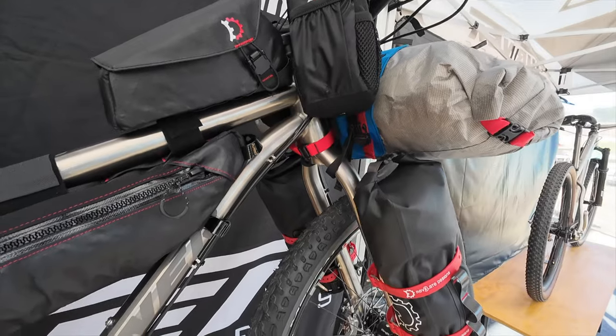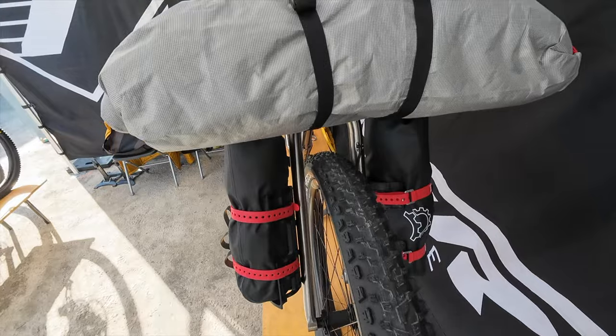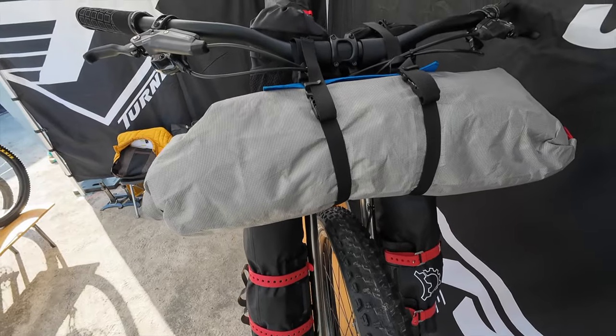In 2024, yeah, I think that in some cases a little steeper head tube angle actually is going to work better, especially for those that have been riding a long time, do not want the super slack head angle, or have a load on the front of the bike with a really slack head tube angle. The loaded front end makes it ponderous.